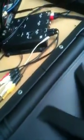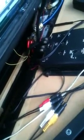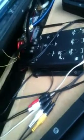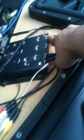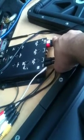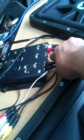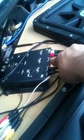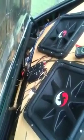And then I've got a Kicker KX 3-way crossover, and I've got the ZR1000 hooked up on the high pass, and then I've got the 2 2500.1s hooked up on the low pass, or on the subwoofer. And I've got subwoofer outputs coming from my radio into the rear side of the crossover, so the rear output will be playing subwoofer also when it's all said and done, and then this will be my rear out, and it will go to my back doors, which will be high pass, and then the rear out coming from here will be going to my front door subs. I'm gonna have 8-inch subs in my doors. That way I can cut off the lower frequencies to where they only pick up 50 hertz and above. And then I think that's all I need to show you back here.